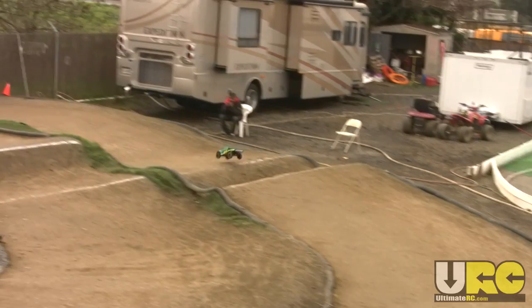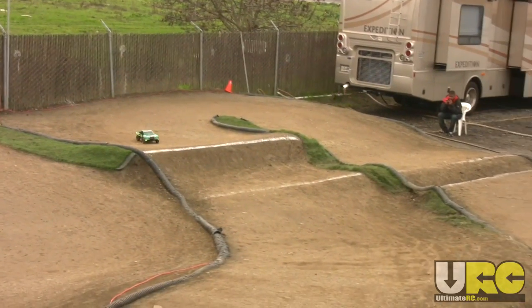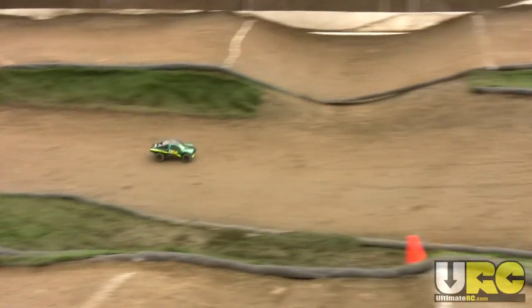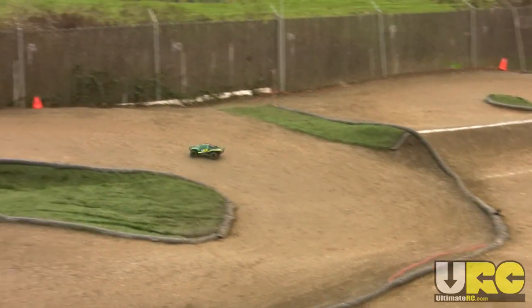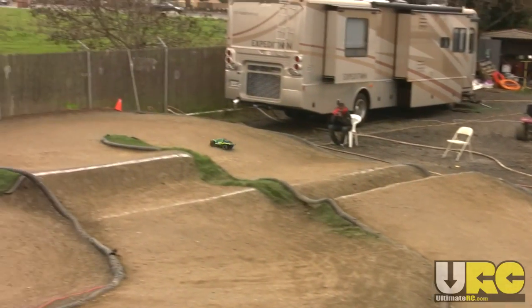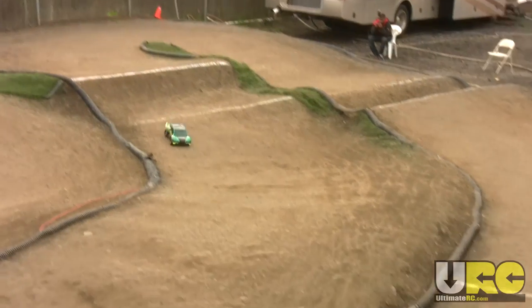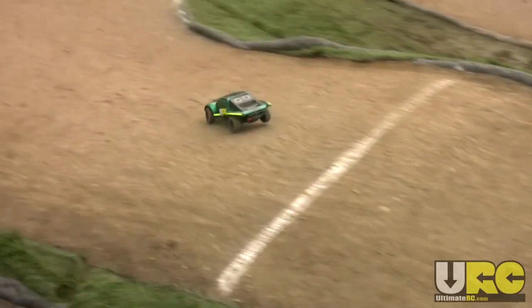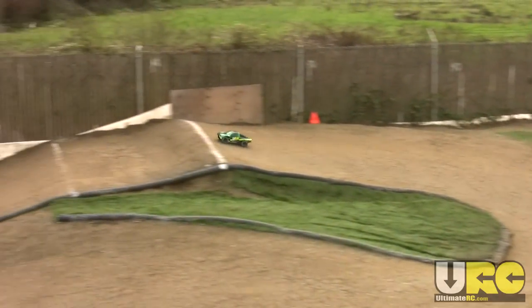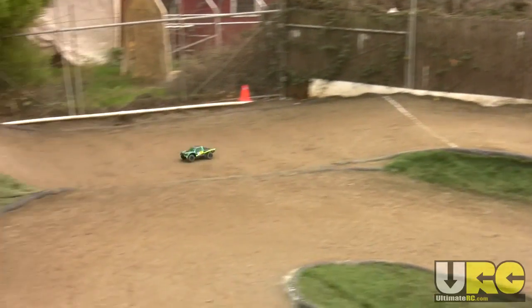Now, during the time that I was waiting for the replacement motor to come in, I also was watching the bulletin boards and the forums for other people's feedback about this motor system, and I found that I was not the only person to have a rotor debond from the shaft. So it appears that this is a common problem. It's certainly not a freak little accident that I had with mine, and it's caused by just a poor type of adhesive that's used that's not strong enough. Right around 160 degrees Fahrenheit, pretty normal temperature, is where that is going to debond.